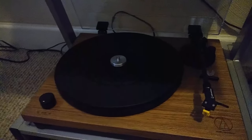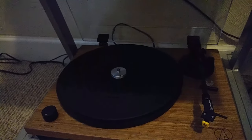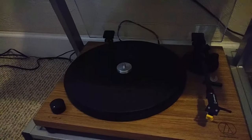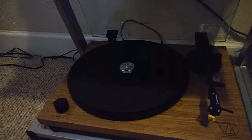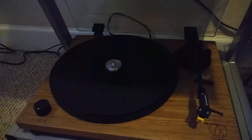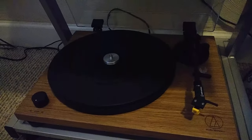This is my secondary turntable, and I use the built-in preamp. The thing I don't like about this turntable is that it tends to be kind of boomy — lots of bass and the high-end is a bit rolled off. However, if you use a high-end Audio-Technica cartridge like the VM530EN or the 540ML — those tend to be a bit bright on regular preamps — it just about equalizes out and sounds good. With the 91B, it sounds good enough for what I use it for: mainly listening to 45s and testing records I buy at yard sales. I use this first because that cartridge is relatively inexpensive and replacement styli are super easy to grab.